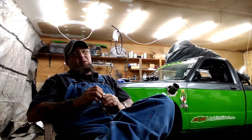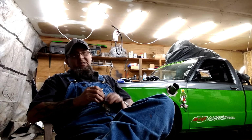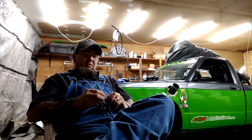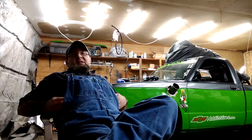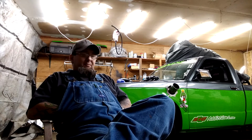I can't remember the exact cc's on the domes, but I know I messed up when I ordered them. They were supposed to be a 23 cc dome, which would have made this about a 9.6 to 1, 9.8 to 1 motor for the turbos. But it's a little higher than that. Rings are Total Seal gapless TNT series. They're gapped for boost. It's a balanced rotating assembly.